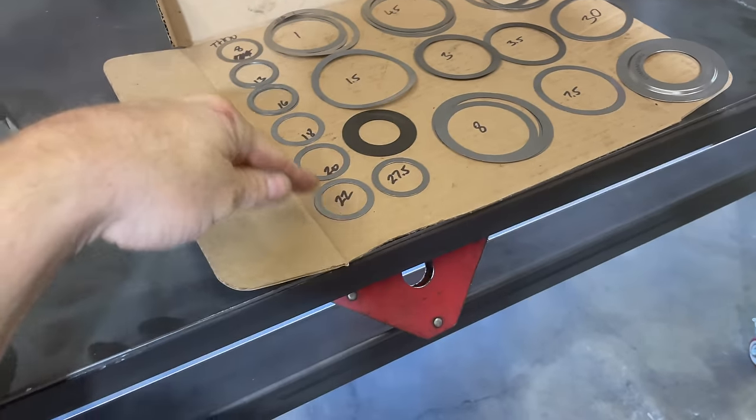You're midway between the tooth and actually got a pretty good pattern in there. On the other side, the heel is just on the back side of the tooth — I'd like to bring it up a little bit. This is the track from the pinion — this is your coast and then your drive. Your drive is really good; your coast is a little bit smushed. You can't change your coast without changing your drive — you'd have to change the pinion depth, which changes everything. You actually want it deep and in the middle, which you have on your drive. So if your coast is off but your drive is good, leave it.